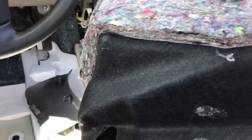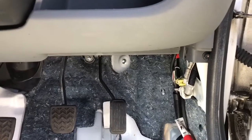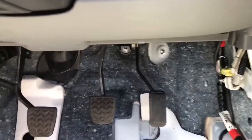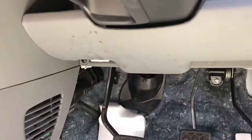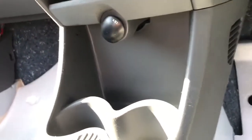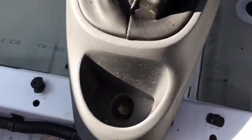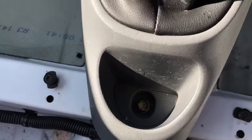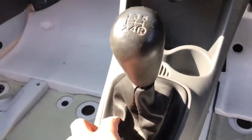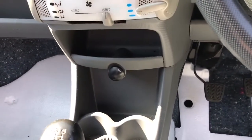So the stripping of the interior has begun, getting the carpet out. At the front there's a panel on the right side that needs to come out - needs a screw at the top and the bottom of the dash. There's a popper underneath in the centre which just pops out. It runs underneath this central console piece. There's one bolt in the little pocket to remove, then it pops up. The gear surround just pops off as well and angles up and out from the connections with the bottom of the dash.